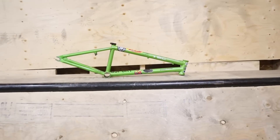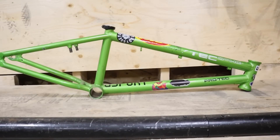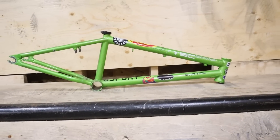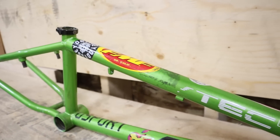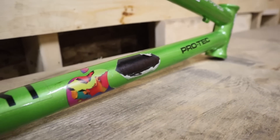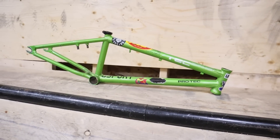What we have here is a We the People Curse frame that would have come from a complete bike. It's full chromoly tubing, which is what you want. The BMX industry has seemingly all agreed on a lot of things with their frames, like sticking right around the four to four-and-a-half inch head tube lengths, 25.4 seat posts, press fit BBs, integrated headsets — the list goes on.